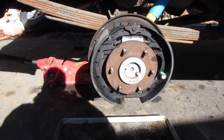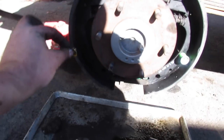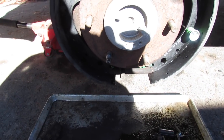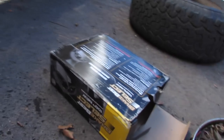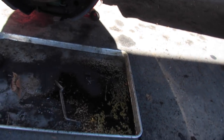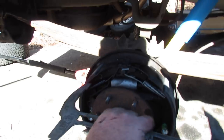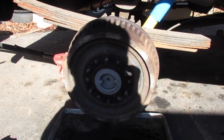This is the kind of crap that annoys a fella — the adjuster goes right there, but it won't fit in the hole on the new brake shoe, so I've gotta drill it out. The shoes are right other than that — I don't know where they're made but I've got a good guess. I just used my handy Emco safe-set to set the brake shoes at the correct diameter. All you do is set it in your brake drum like so, and then slip it over your brake shoes. Seemed to work very well.